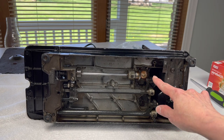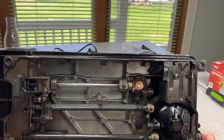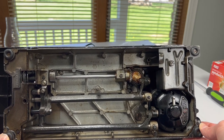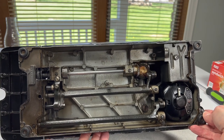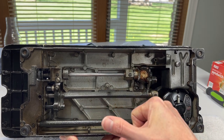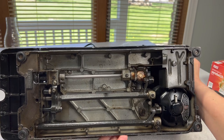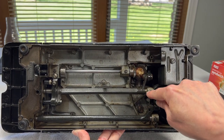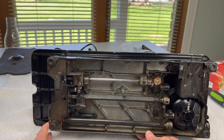Now what you're going to be looking at is these gears right here, and they are just like the other ones — extremely gunked up and greasy. Honestly, I don't know what kind of grease this is; when I show you the kind I'd recommend using, it's not that color — it's like a very light yellow. If your machine is frozen, anywhere where metal is moving on metal you might want to add a little oil. Let me give it a couple turns so you can see parts moving. We have movement here — add some oil right here, add some oil here, here's a good place for oil, and there's even a little hole where you can put oil. Do not put oil on the gears — it's not supposed to go on the gears.